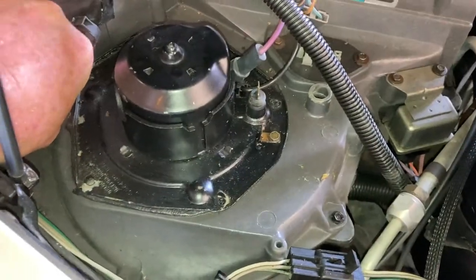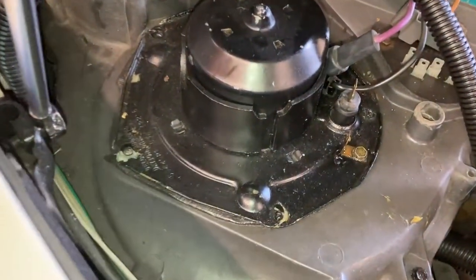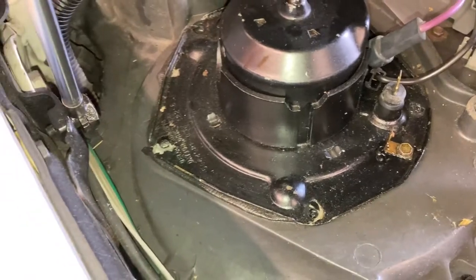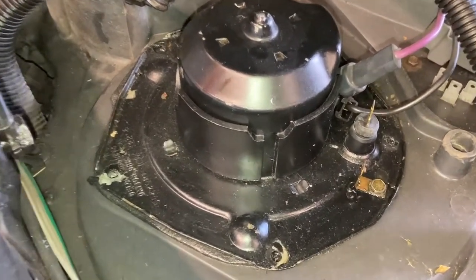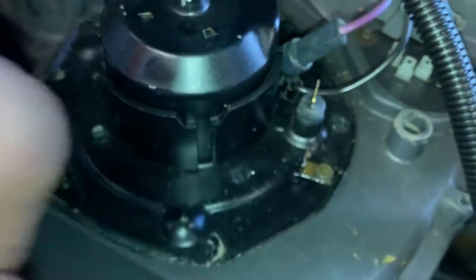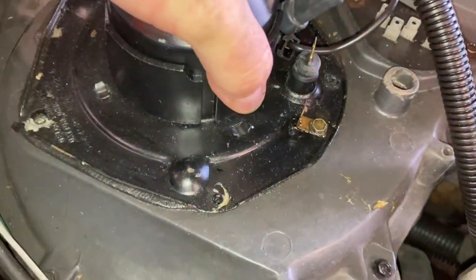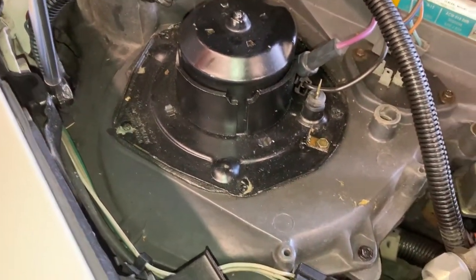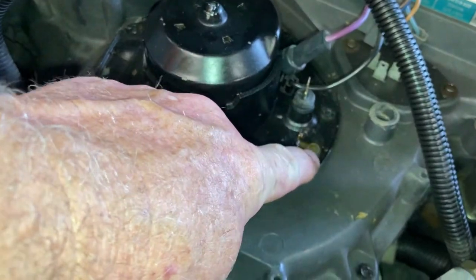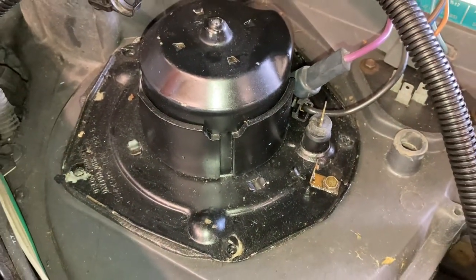So yeah, these are all of a type. These quarter inch coarse thread screws. Now what a lot of people always want to know is, listen, how do I know where this motor goes back? And there's the ground, right? In the case, that's your answer. It goes right in a hole, in an indexing hole. And look, this one's never been out, so I'm going to have to pry it loose. But this you never have to disturb, that ground lug right there.